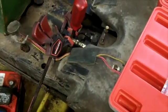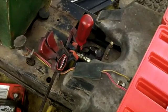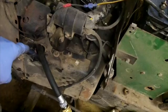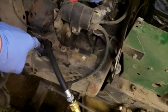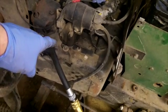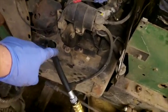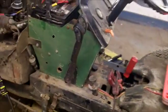What you want to do is rotate the engine over to top dead center on the compression stroke. Since I have the seat off, I'm using the driveshaft with a pry bar in the U-joint and I have it clamped. You can put your finger in the spark plug hole — as it stops blowing air out, both valves will be closed. This is a flat head so you can take a flashlight and check that both the intake and exhaust valves are closed. Some older ones have a compression release that floats the intake valve just a little on the compression stroke for easy cranking. I've got this one set at TDC and clamped, because when you put the air to it, it will try to push off top dead center.